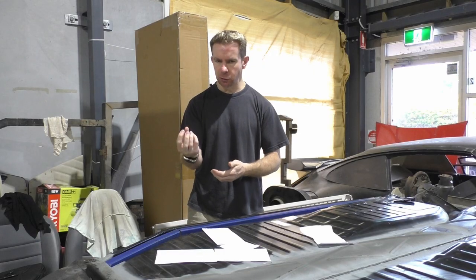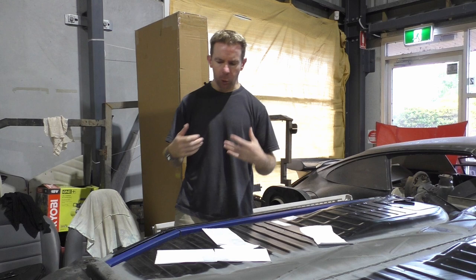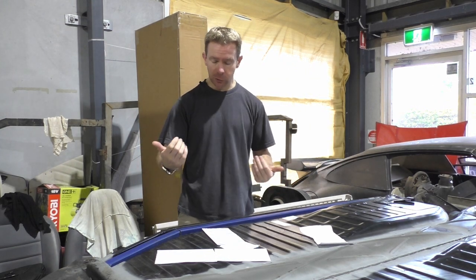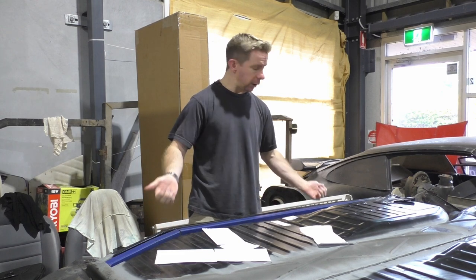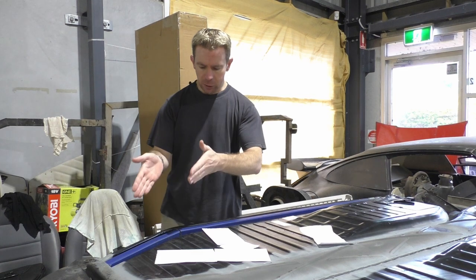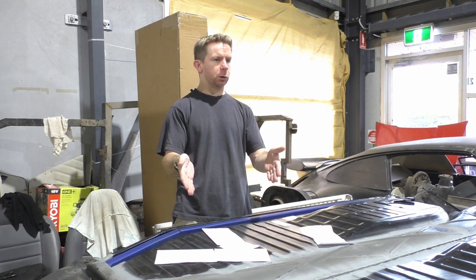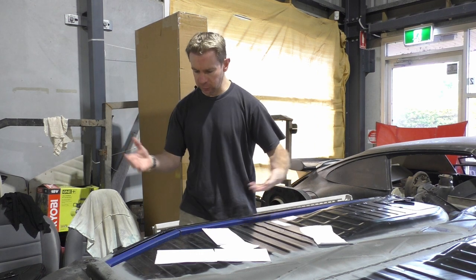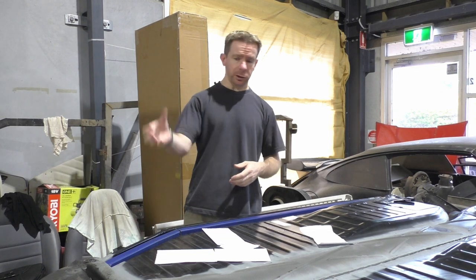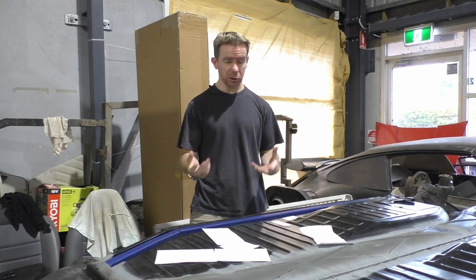They don't fill the entire hole as such. So with that being the case, what I'll be doing is welding this up, putting some sleeves in here in the future when I do the holes, and then the bolts that I get, I'll get some high tensile bolts and everything. They'll more or less rest within those. I did say the word before, but my mind's a little foggy today, so the holes, put it at that. So when I put them through, clamp it down, obviously, it should be okay. I can't see a real problem with that.